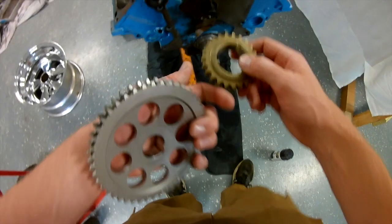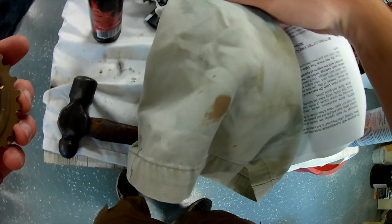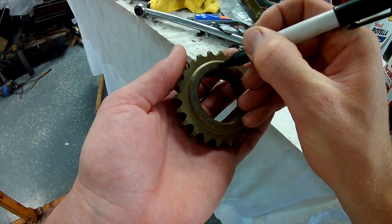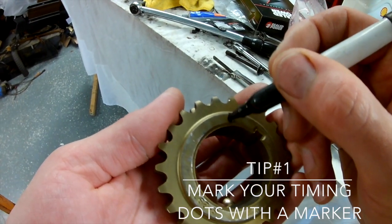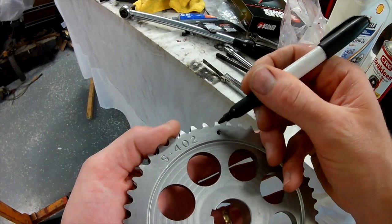My main goal for this one was to get my timing chain on. Here you see me with it — this is the Sealed Power kit, it just had that part number up. Basically what I'm doing here, I've got my bottom gear and I'm finding my marker. I like to mark my dots on the top and bottom gears so it's real plain and easy to see at any time, so that when we line these up in a minute they're directly in line with each other.